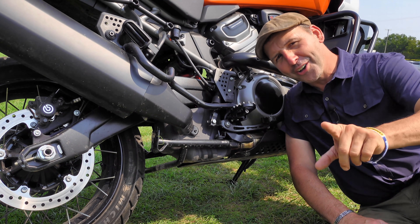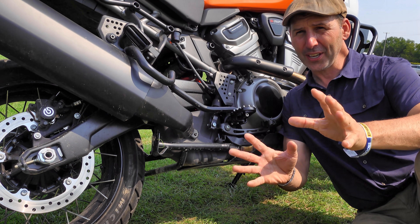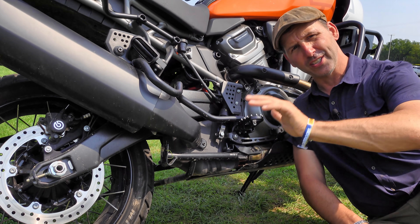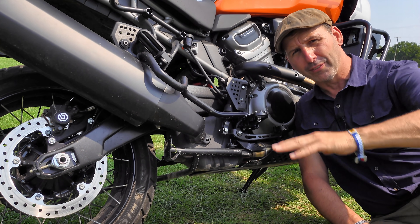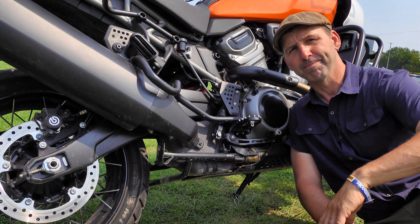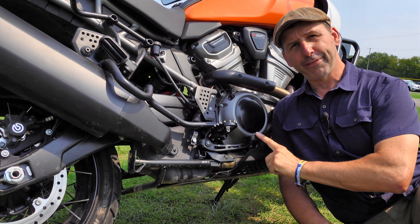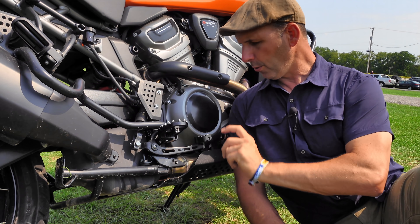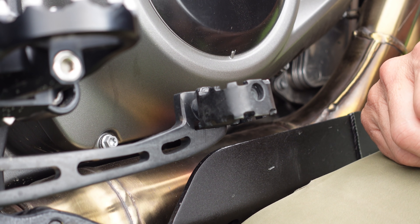When I started braking with rear only to investigate that feedback, I also discovered the bike has no squat — and that's not necessarily a bad thing or a good thing. It's just an interesting note that when I was loading the rear it didn't squat at all. I assume that has to do with the hydraulics in the auto ride height adjustment system. On a nice note, they do have an adjustable toe on the brake lever so you can pull it out and spin it for a higher or shorter position — from standing to sitting.